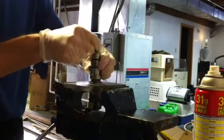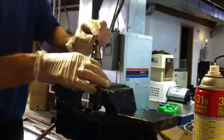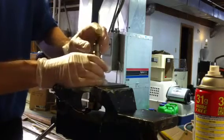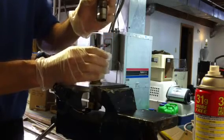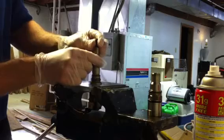I took off the copper washer already — I just used a box cutter to get underneath it and lift it. If not, you could just wait and then the nozzle would come out separately. The only problem is the metering pin itself might slide out on you. If you weren't expecting it, you wouldn't want to have it bounce on anything hard because it could bend or damage it. Highly unlikely but possible.